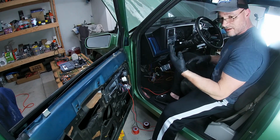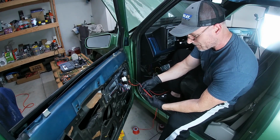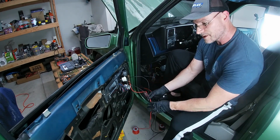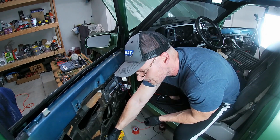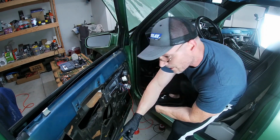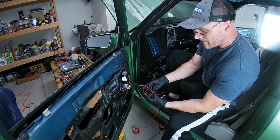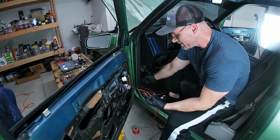So as you saw on the passenger side, I am removing the wires and running them back. On this side here, we're gonna do the same thing, except there are two extra connections going to this door. There's an emergency pull out of here. It's hard to see, but this right here is like a bicycle cable, and that is run from the latch, and it's hidden somewhere on the car. Then I have a ground cable, which goes right here to the inside of the interior.